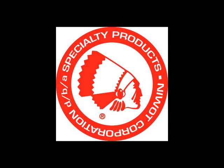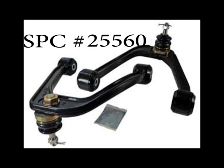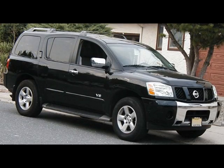Welcome to the Specialty Products Company installation video for the 25560 Titan Adjustable Upper Control Arm. This control arm will produce 1/2 to 1 1/2 degree camber change and 0 to 2 degree caster change for the 2004 and up Nissan Titan and the 2004 and up Nissan Armada.